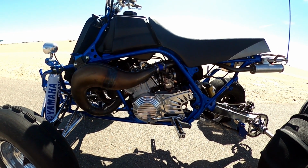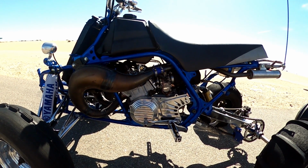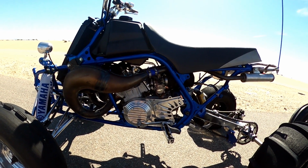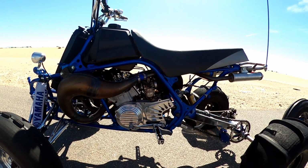This is a 472. This is a 72 millimeter bore on a 58 millimeter stroke running a 115 rod. It's a 4 mm stroker. It's a Cub. It's called a Super Cub. 4 mm Super Cub, 472. Okay, on to this guy.